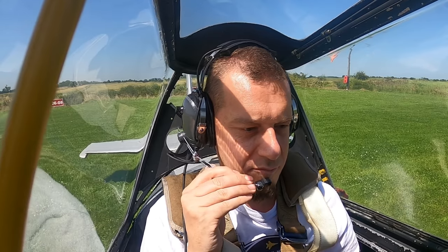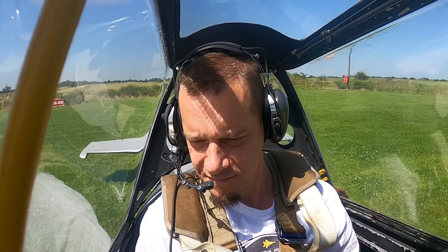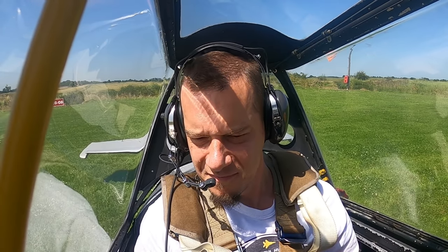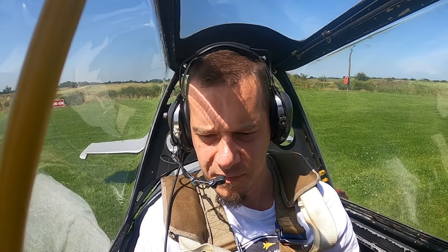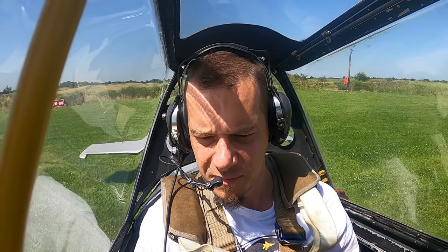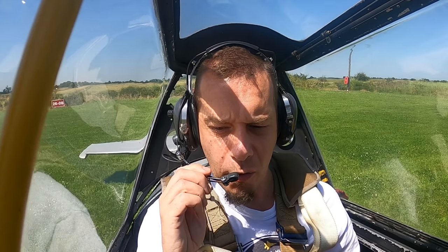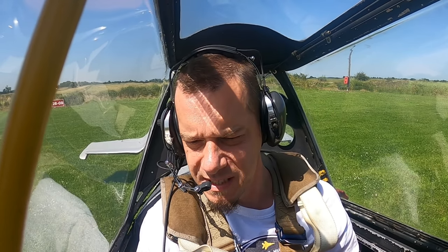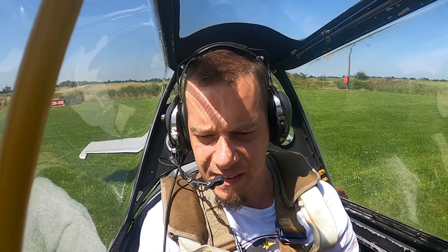That's both mags back. Carburetor heat comes on to make sure there's no ice in there. And believe it or not, you can get carburetor icing up to 30 degrees ambient temperature outside if it's humid. Carburetor heat back to cold, RPM rises slightly, that shows there's no ice. And then back to idle to make sure the engine's responding at idle. Cold temperature very low back here. Give the gauge a tap. It should be about 35 degrees temperature.